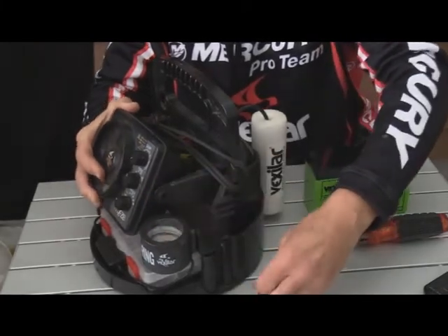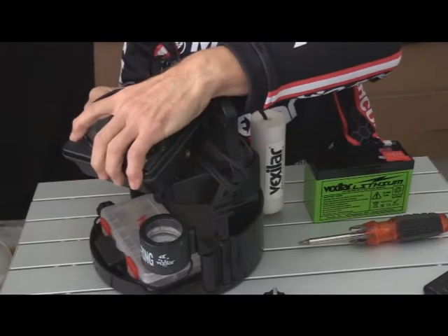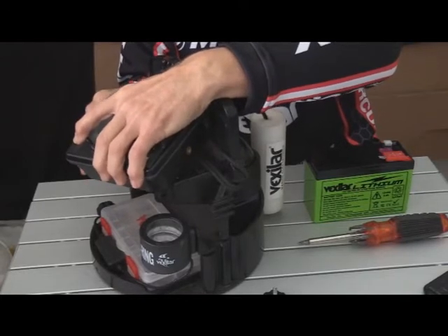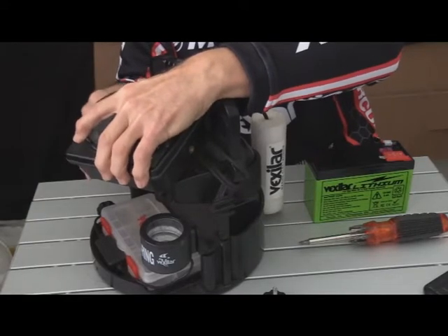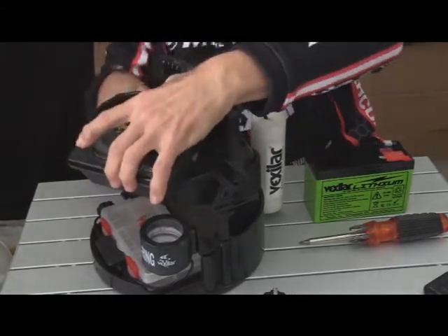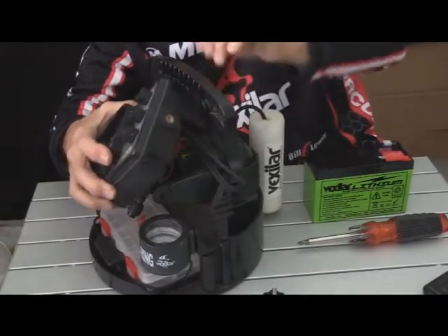It takes a bit to do this. Now you've got your wiring right here. What you want to do is disconnect your attachments — your transducer. In my case, the FLX-28 has a pro-ducer. I'll wiggle those off. Make sure that when you put these contacts on, they're on good. I've got this one on real good — in fact I've even got it caught in here.